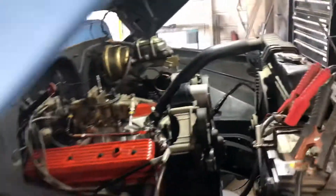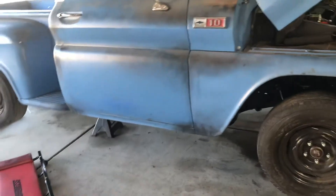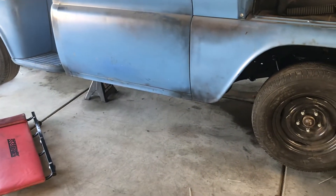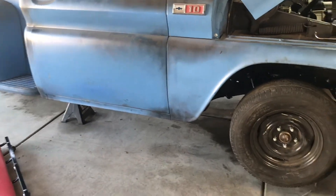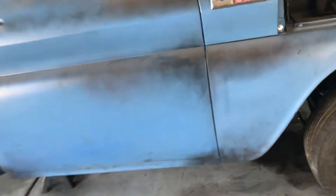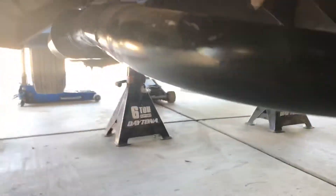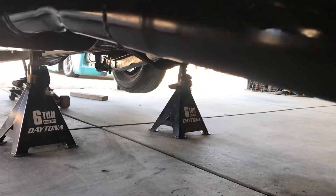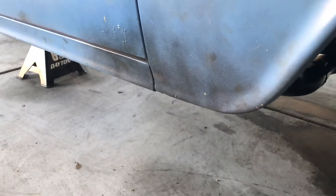Since the last time I did a video on it, I wanted to show you guys what I did with the exhaust. I had mentioned before that once I lowered it, last time I wasn't able to take it out because the mufflers were sitting on the floor — only about two inches off the ground because they were run right down the center of the frame. Looking online, a lot of people who bag these trucks run them out the side, straight down and along the frame at the frame rails so they can lay all the way down. I'm not planning on bagging it, but that eliminated all my rubbing issues.